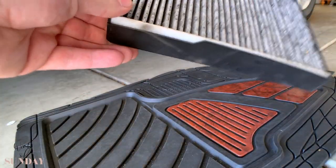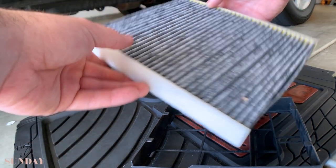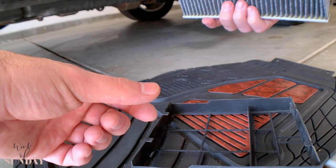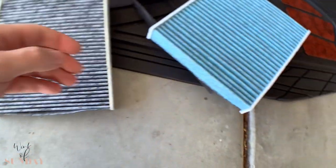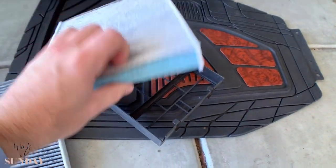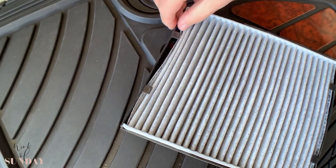Air filter out — I'll just take this air filter out of here. Remember, don't flip the casing; you don't know how it goes in. And here it says 'up.' It would be nice if it said 'airflow' — it just says 'up.' If you look closer, you can see all the dirt in here, also on the edge. I would put airflow this way — the other way around. Just by taking a look at the old filter, I would say the dirt comes from the top, so the fresh air comes in from the top. Airflow is downwards. Just make sure you have it somewhat latched in here — 'up' goes up.